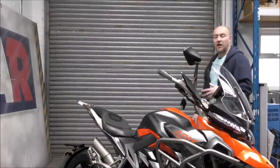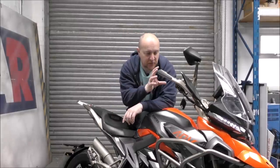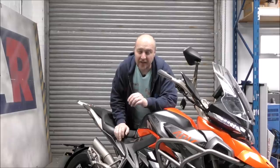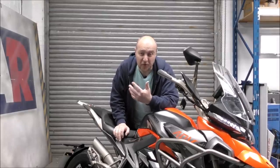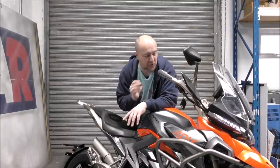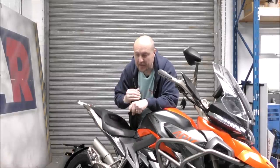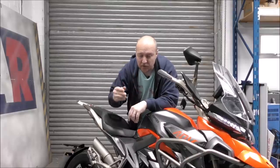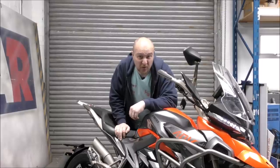Now, one thing I will say that I tried to say on the bike, but I don't think it came off very well because of the wind, is that it switches from eco mode to sport mode automatically when you get to 7,000 RPM. It did do that. There was a slight difference, not a lot. But when it's in sport mode all the time, you can definitely feel there's a better pickup, because it uses a different mapping system for sport mode than it does eco mode. I do like the fact that if it's in eco mode at 7,000 RPM, it recognises the aggressiveness of your accelerating and switches to sport mode and then back to eco when you come off the revs. I don't know that I would bother, to be honest. I'd probably just keep it in sport mode all the time.